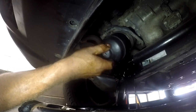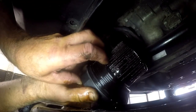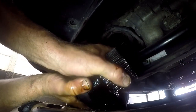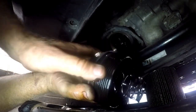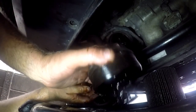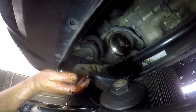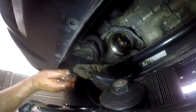You can see all the oil coming out there, and then we have our oil filter attached to that unit which just basically pulls out quite simply. We'll let that drain nicely, and then we'll take our oil filter holder and go clean it out nicely with some engine cleaner. Let it drain sufficiently until it stops dripping, and then we can go ahead and reassemble everything.